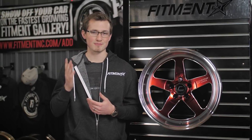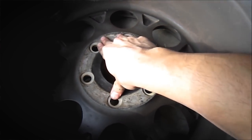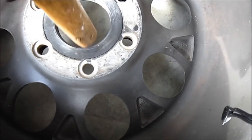If your aftermarket wheel has a smaller hub bore than what your vehicle allows, you are going to experience that some things just simply will not fit. So make sure you're keeping an eye on that when you're buying wheels and tires. Another thing with hub bore, you can get adapters. If your aftermarket wheel is going to have a larger hub bore than what the vehicle has, you can get adapters to help make sure that those fit nice and snug. Hub bore helps, especially when you get the right sizing, to minimize any sort of vibration and improve the overall drive quality of your aftermarket wheels on your car.